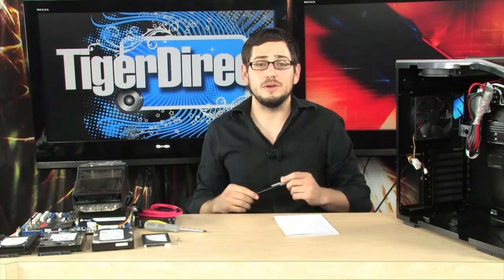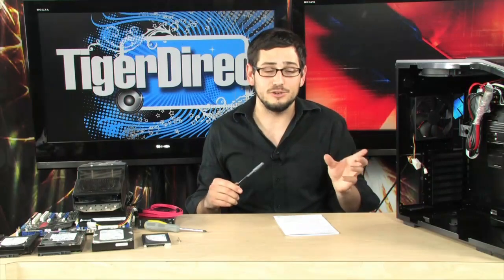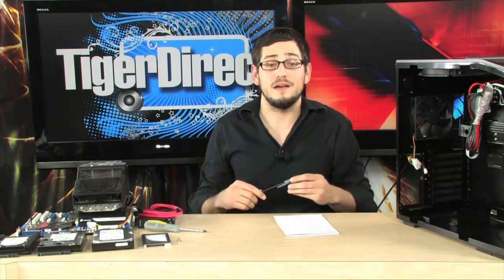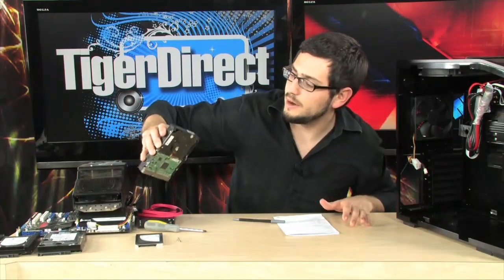You've got to make sure that you get the correct hard drive for your computer. If you have a modern computer, it's going to be SATA — Serial ATA — which is the most commonly used connection, or interface, right now. A lot of older computers have IDE, or that big fat ribbon cable. That is PATA, or parallel, versus serial.